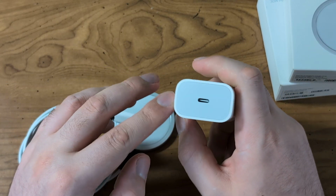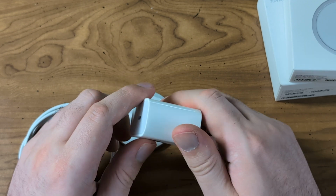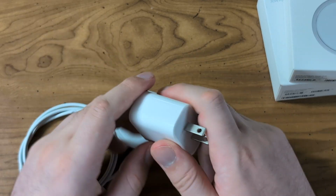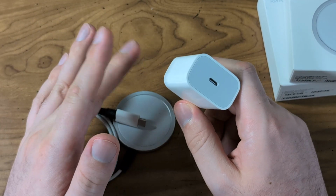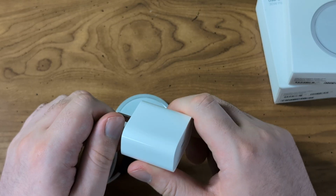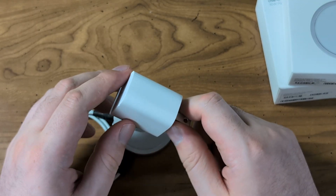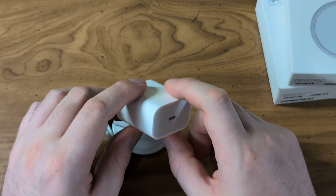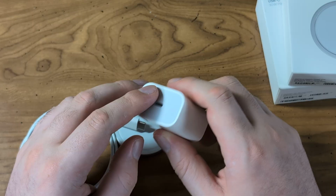Like Pixel 5, Pixel 4, Pixel 3, etc. Maybe even the Pixel 7 Pro that I had. No, the 7 Pro was up because I had that dedicated wireless charger that doesn't work with the 9 anymore. Yeah, they made a dedicated desktop one. It might have been 7 or 6 and 7 Pro, I guess 8. Either way, Google uses a proprietary wireless charging if you want to go faster than, what is it, 15 watts, I think. Or maybe even to enable 15 watt wireless charging on the older devices. Either way, it was 18 watts, which is actually 9 volt 2 amp. So on the Pixel 9 Pro, it actually does 27 watt quick charging.